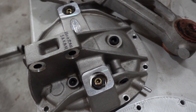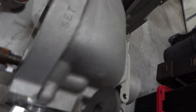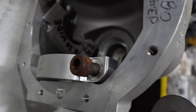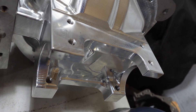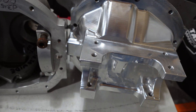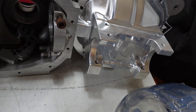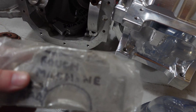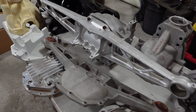There's the C4 and the C2/C3 mount for it, but you can also use the Ford Performance racing cover with the load bolts on it. This one actually has the load bolts kind of built in — it'll butt up flat to it. We have a couple different cap options. All our caps are billet and machined into the cover or machined into the housing straight across. Here's a flat one for the Ford Racing cover where you can back up those load bolts to it.